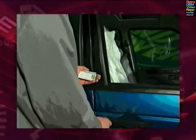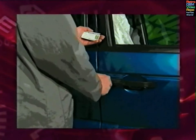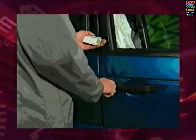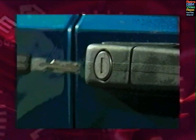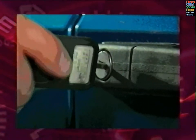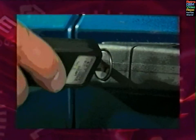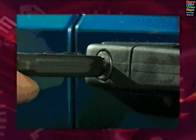You may already be familiar with EKA entry on Range Rover and Discoveries. The 4-digit code is entered by turning the key to the unlock position the number of times in the first digit, then to the lock position for the second digit, and so on. But the 96 model year Range Rover features passive immobilization. Before entering the EKA itself, turn the key to the lock position 4 times. This will lift the immobilization from the car, after which the EKA can then be entered as normal.